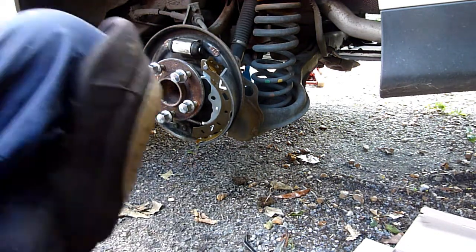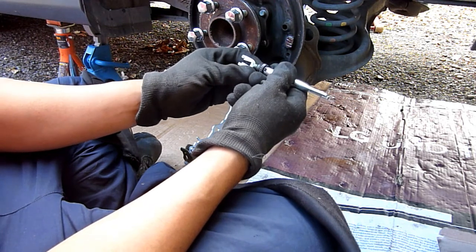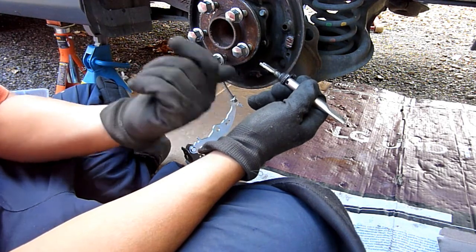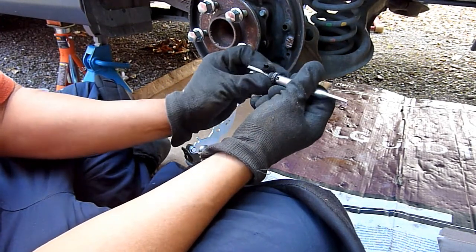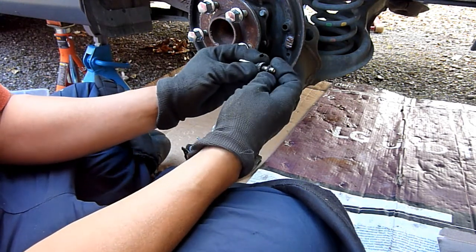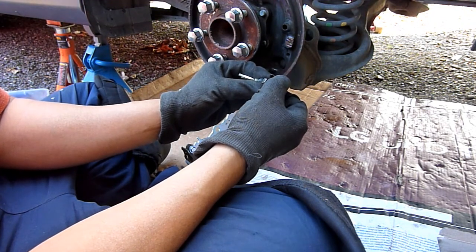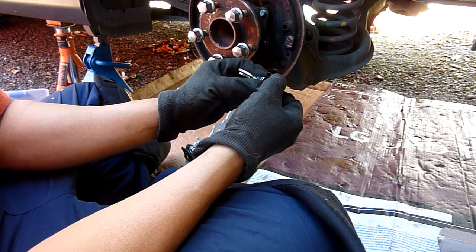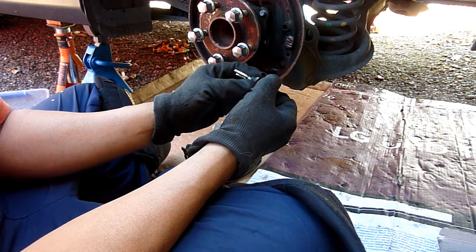Okay. It makes sense to me that when it's old, the ratchet system will ratchet the brakes that way. So when it's new, I think this goes to the rear. It sits in there, and this plate here helps the ratchet system. But it makes sense to me though, when it's new, like on a disc brake, to wind it in a little bit. I'm not going to do it too much. I would have thought that would help. I mean, I can wind it in all the way if I want. Because I'm working on a slope, when I lower the car, remember, I have no handbrake. I just got to remember that. So I wound it in two winds.